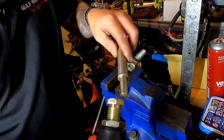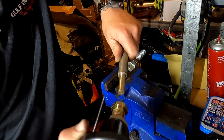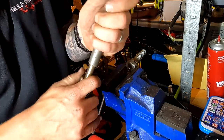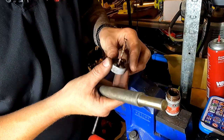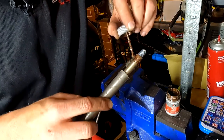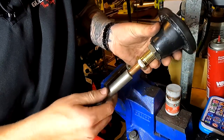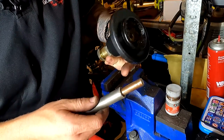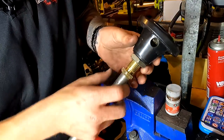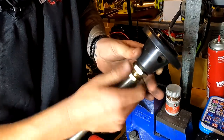So now that we've got it off, that is just going to slide directly inside here. So that's going to be a bit stiff, so we need to... oh, there we go. I'm going to grab a bit of CU800 paste — or copper paste, whatever you want to call it. All we're going to do is grab a bit of copper paste and lather this thing in it. That way, when we install it, it'll help go in easier, but also help the removal process down the track if we ever need to pull it out again. See how I applied the grease at the end of the shaft? And then now it's moved all the way down — that's exactly what you want to do. You don't want to cover the entire thing, otherwise you're pretty much just wasting it. So we're going to make this as short as we possibly can — that way, when you get it back in, it's going to help it go in a bit easier.